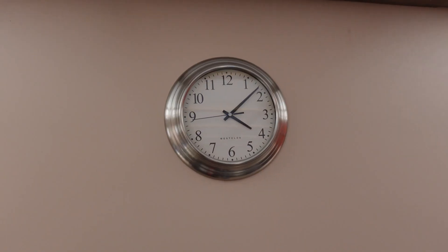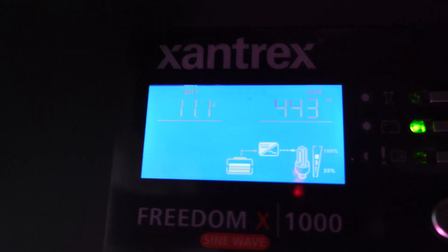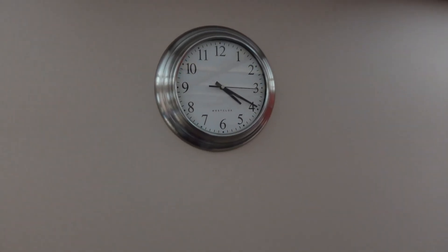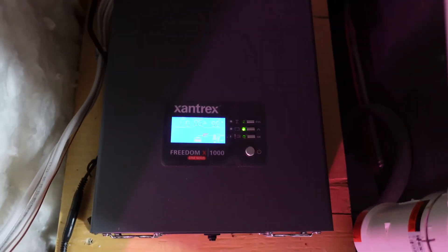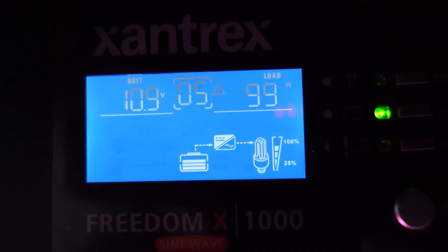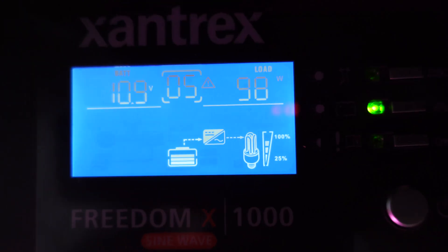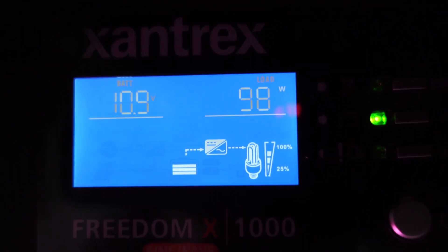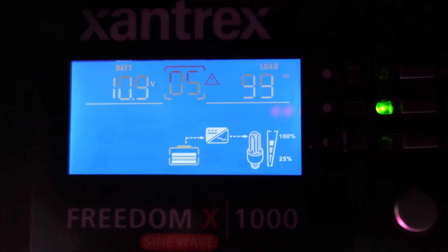Coming up here at 10 after 4 — now we're going on 6 hours and about 15 minutes. This is the first time you can kind of see 11.1 volts, running again at 440 watts. Then I heard a new beep at 4:20 — a new beep meaning it's coming from the Xantrex — so I ran right over to take a look. It's showing 10.9 volts and I've got an error 0.5 warning, which I did not know about at the time, so I'll pull out the book and show you guys. 98 watts used, furnace fan is running, everything is still operating normal.